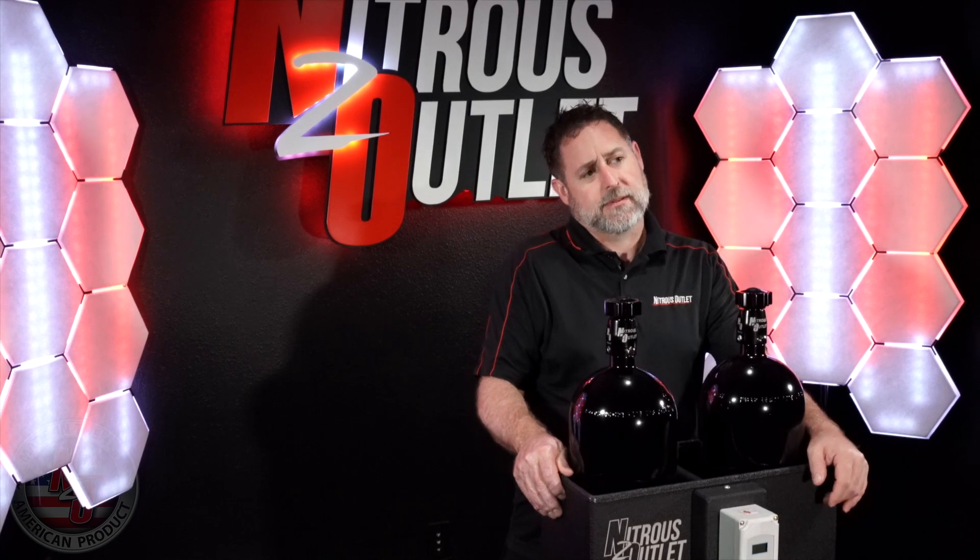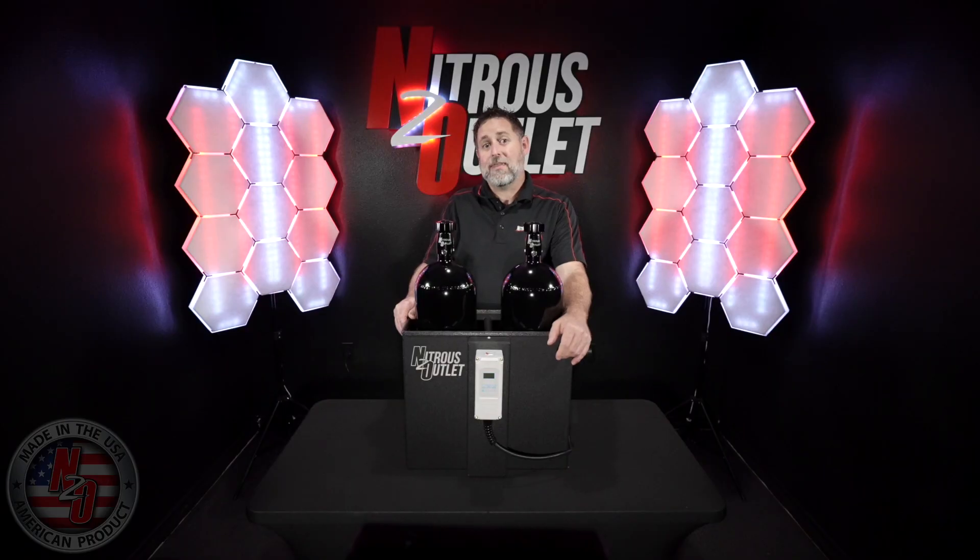How about a few important tech tips? It is important that you add the water before plugging in the heater. Plugging in the heater before adding the water will result in burning the heater element out. In the event the heater element or the control module were to go bad, we do offer replacement parts.